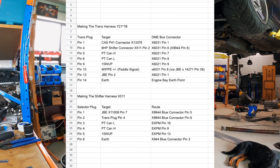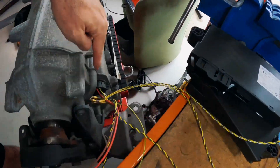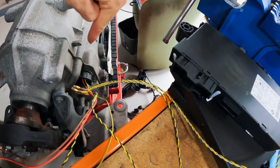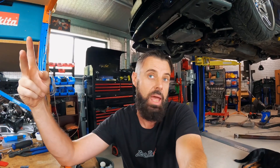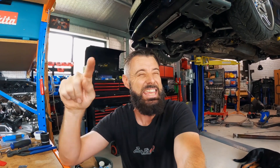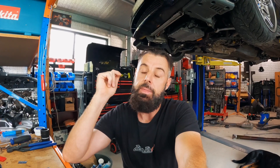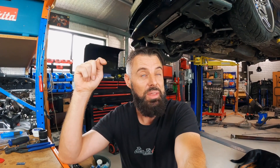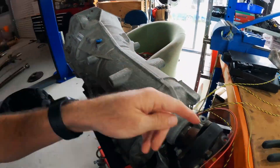There are a couple of things that have caught me by surprise. One is how hard these transmission plugs are to take apart. I've got this one here which we picked up from Simply Tuning - this is an F-series transmission plug. All the F-series that run 8HPs have two CAN buses connected into the transmission. The E89s and E84s do not - they don't have PT-CAN2 going into the box. The problem is the wiring for the E84, which I want to use, is different to the wiring on the F-series, and I can't take the plug apart.